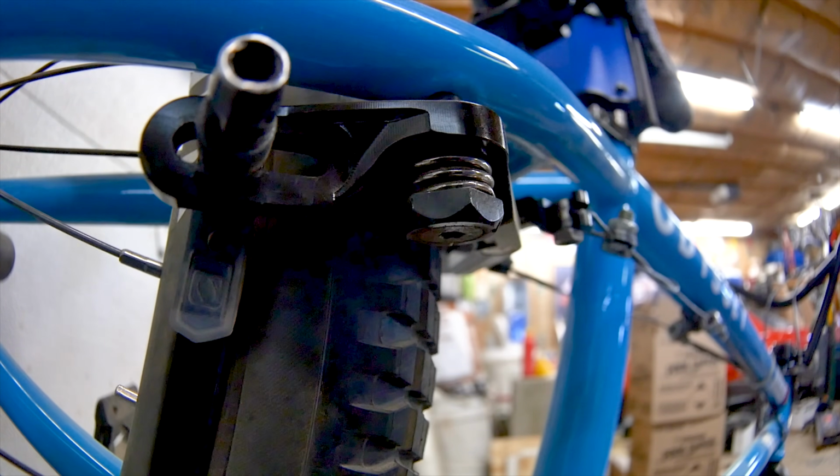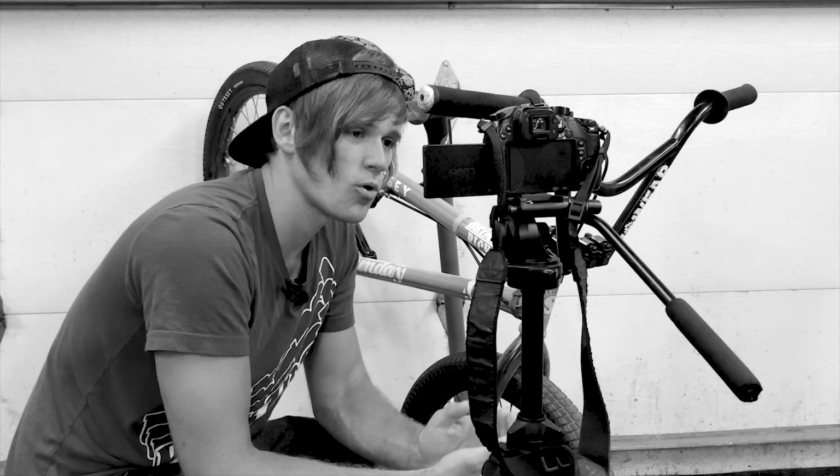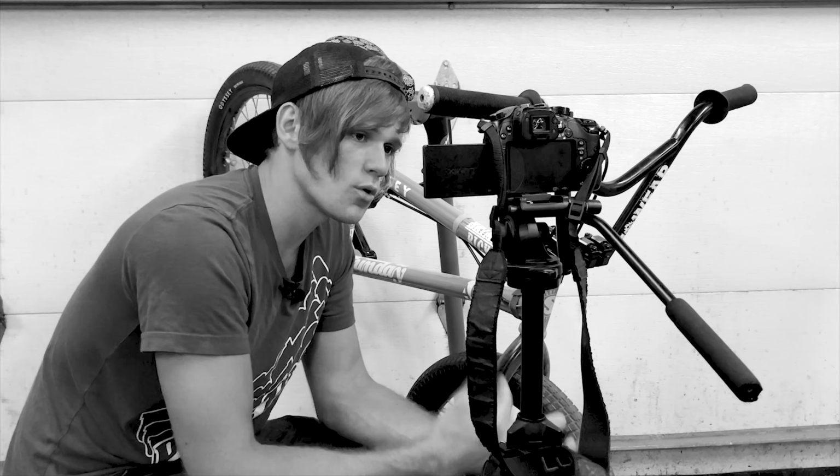It's not exactly straightforward because it's totally subjective in how your brakes feel, and how you like them is totally up to you, and it can take some trial and error. And depending upon your brake setup, for instance, if you have a straight cable or a double to single lower cable, you'll have some sort of straddle cable setup, which is affected by brake spring tension because both springs need to be relatively even in their tension so that they're returning and pulling about the same on the brake cables.